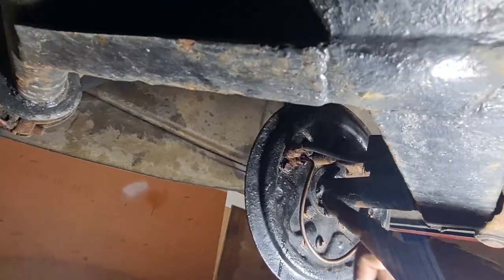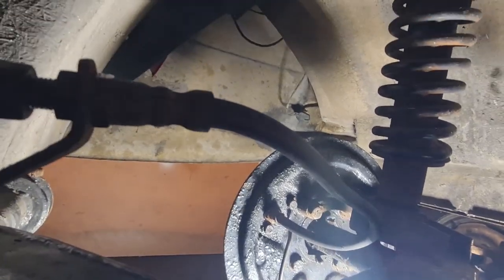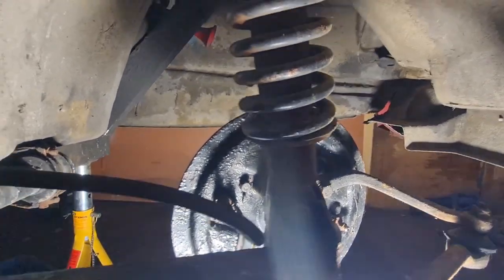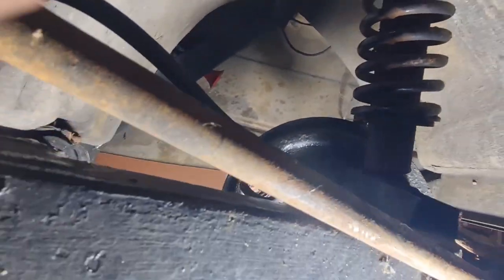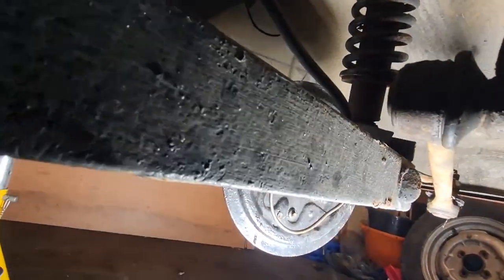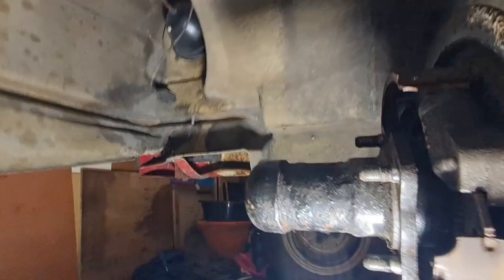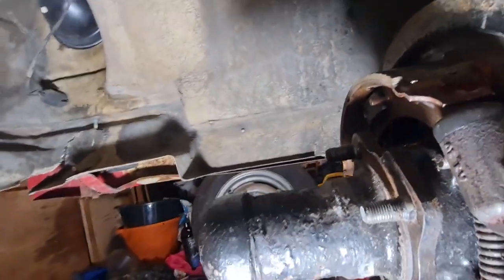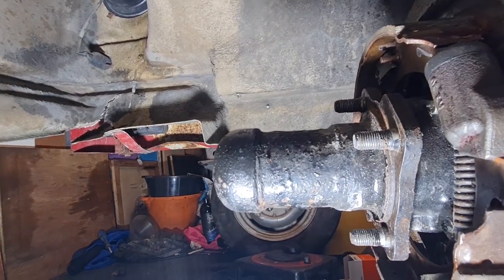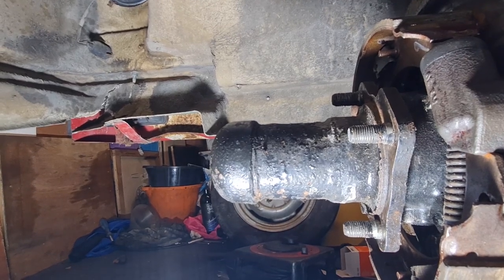Everything is back on - the metal pipe back on, the flexi hose back on. One thing you need to make sure when you put the flexi hose back on is that you've got clearance the whole way. If I turn the steering all the way to the left, we've still got a small gap between the hose and the A-frame, so nothing will rub. It was actually touching before, so I just readjusted the angle. The cylinder also has the new boot on it now, looks nice and clean, moves freely, slotted back in between the shoes. So I'm going to leave the front now and move on to the rear.